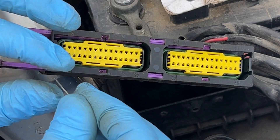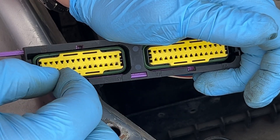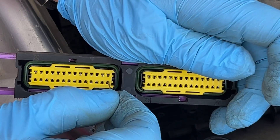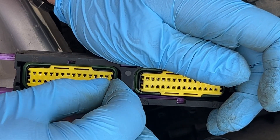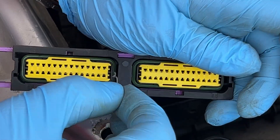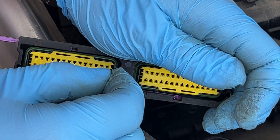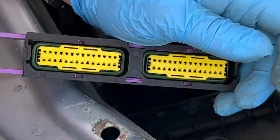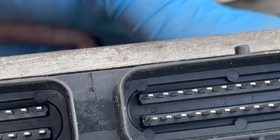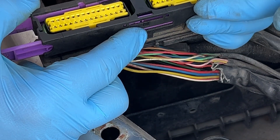I want to show you something. This is a connector pin — when I plug it into the smaller-gauge holes it's very tight and hard to remove, but this one here has a gaping hole. When I plug into the problem pin it springs back — the connection onto this pin is loose, it's not good, especially since I cleaned the connector and that likely took some of the metal out.